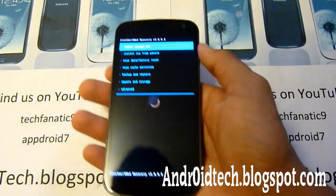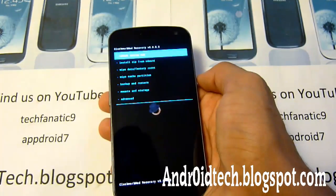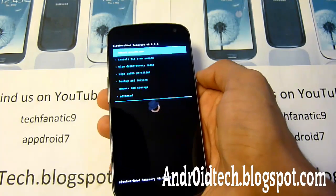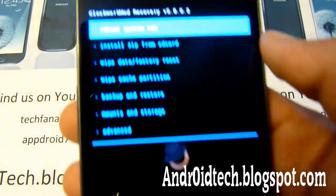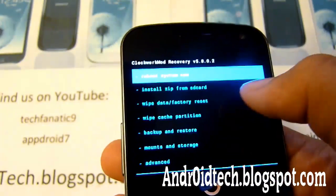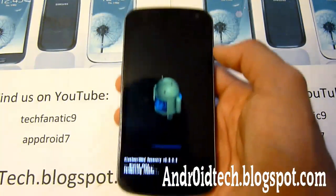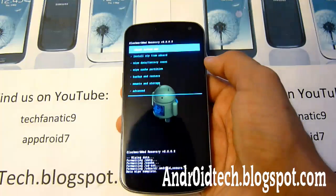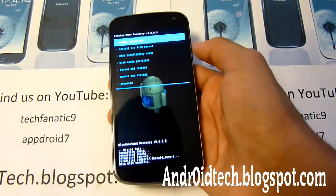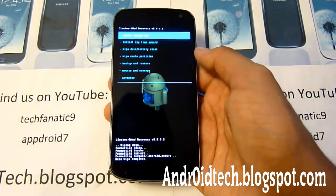Okay, you'll be on this screen now. You've got a lot of options. Now, if you're installing a custom ROM, unless they say specifically not to do a factory reset, always do a factory reset right away. You can see right there: 'Wipe data / factory reset.' Tap on that and tap yes. Always do a factory reset before installing a custom ROM, unless told otherwise — because if you don't, you will get stuck in the boot loop, also known as soft bricking. So in the end, you'll have to do a factory reset anyway.